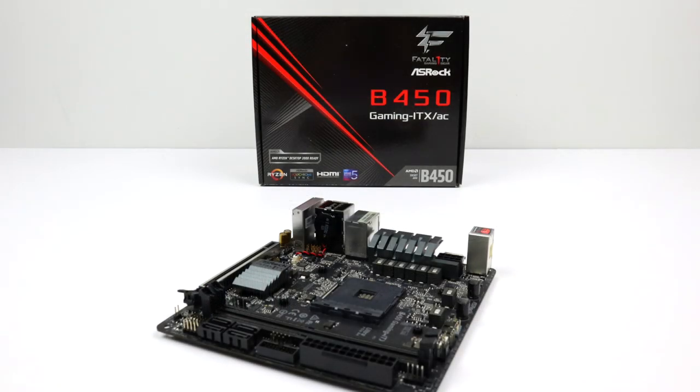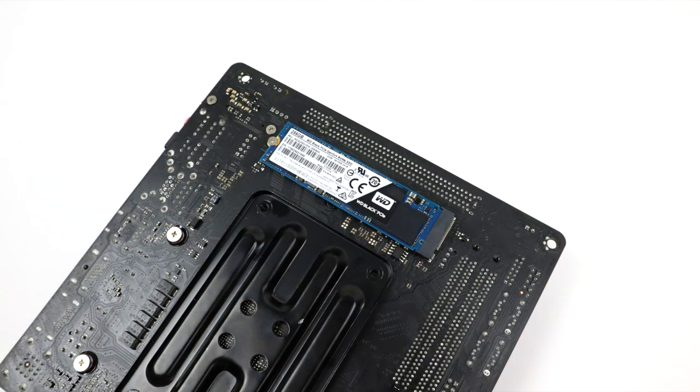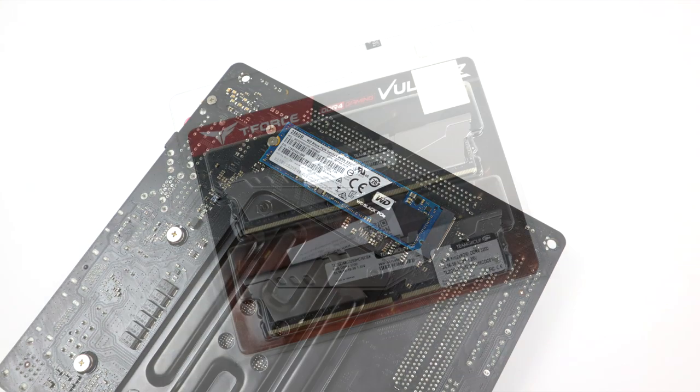For the motherboard we have to go Mini-ITX to fit inside this case, so I opted for the ASRock Fatality B450 Gaming Mini-ITX. Unfortunately with the B450 and X470 motherboards you will have to upgrade the BIOS before it's compatible with third generation Ryzen. AMD is offering a loaner chip — they did this last time with second generation Ryzen. I'll leave a link in the description, or you could hold out for B550 motherboards or spend up on an X570. The Fatality B450 does have an M.2 slot for storage, or you can use an SSD or a mechanical drive.